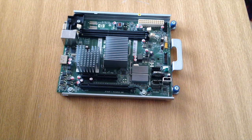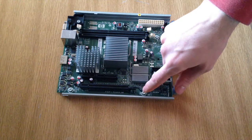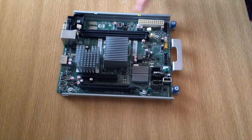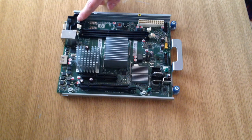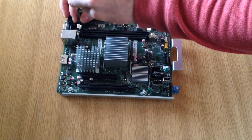So this is the motherboard and tray taken from my micro server. I'm going to be swapping it out for this board here which I've just received from HP this morning. There are four screws on the tray — one here, a second there, a third here, and this one here is a longer screw — so four in total. We'll get straight on taking these off.